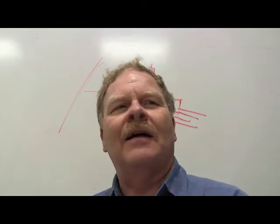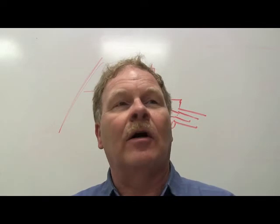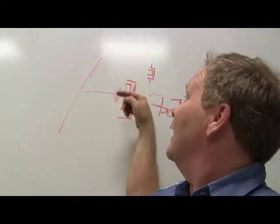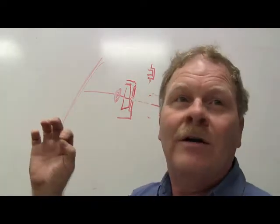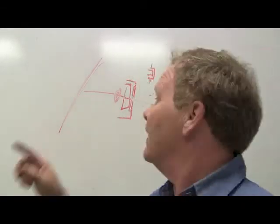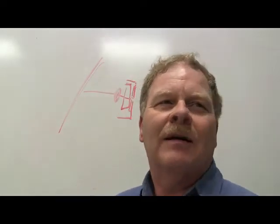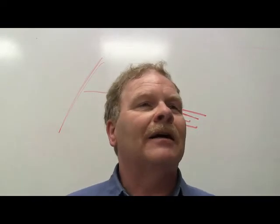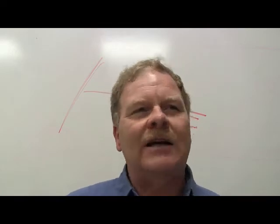So I got to thinking about that. I took some of those things apart, and I said, I think I'm going to investigate this. I figured out what was going on with them. I would blow that out, clean it up real good, and it's sitting in there at kind of an angle, about like that. I would put one single drop of oil, a tiny little drop, like with a hypodermic needle, right in here. For the rest of that speedometer's life, believe it or not, that silly little thing was swimming in oil, and it never messed up again. I fixed I don't know how many of them for $25. But there were some tricks you had to know.